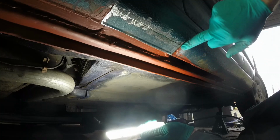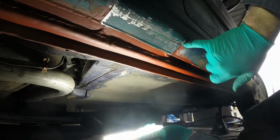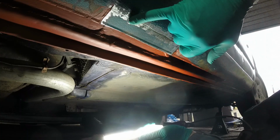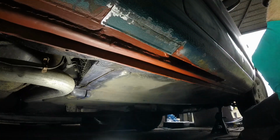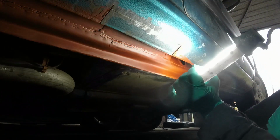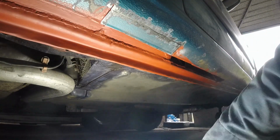So I'm just going to go and get a wire brush, take the paint off here. I'll weld the two ends first and then these two slots, and then I'll put some tacks across that bit just to strengthen it where I cut the metal quite thin. But yeah, that's probably saved me a good few minutes of faffing about.